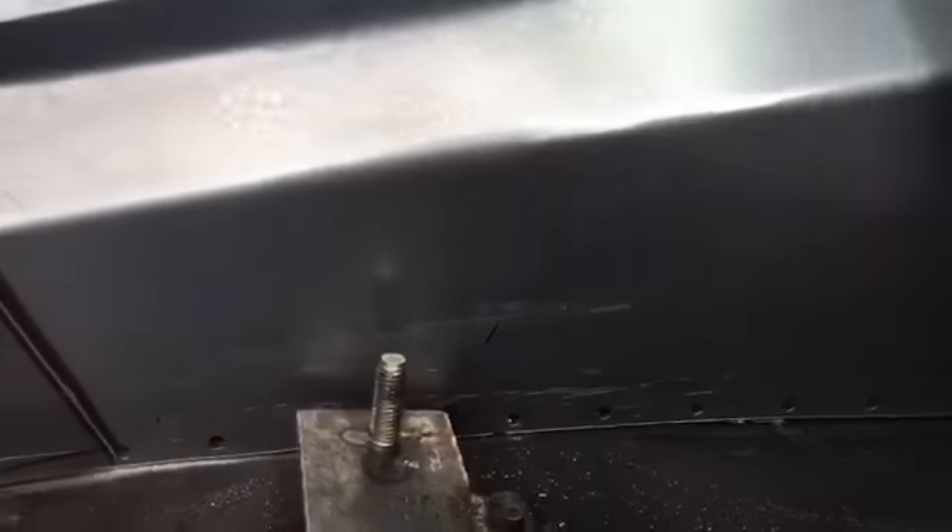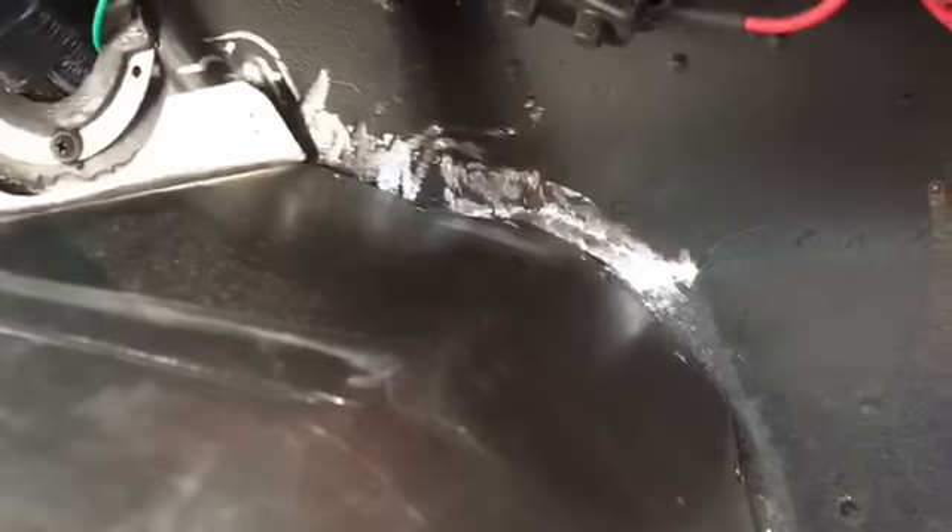I removed it and cut about one inch in from the line all the way around. I then used a hammer and a dolly and some channel locks and vice grips and a couple other tools to bend the floor up at a 90 degree angle all the way around, so that when I put the tunnel back in, it had something to attach to.